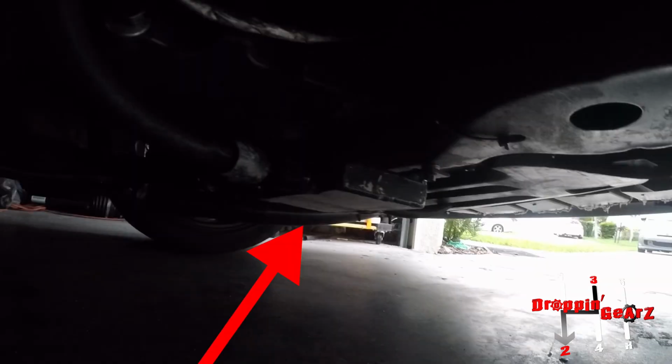And he told me, oh, you need to, the tank, because that little tank I showed before, I didn't know exactly what that tank was. Like I said, I just got the kit. I'm not even close to an expert in turbos. I know more now than I did 5 months ago. And so I learned that tank was an oil tank. It's a return. From the turbos it goes into the little oil tank, and then the pump pulls it from the tank. That's basically the best way of doing it, where it won't back up. So I asked him about the tank, and he told me what it was.